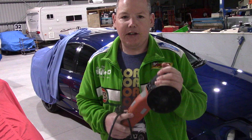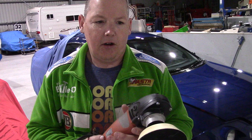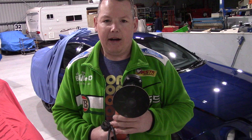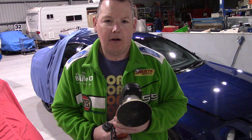This tool happens to start at 200 RPM and finishes at about 1200 to 1300 RPM — that's as high as it goes. One thing I teach my students is that I do no more than probably 1200 RPM, probably around 600 to 900 to correct. I might go a little bit higher, but then I wind the RPM back down, and I blow my pads out all the time during a process on one area.